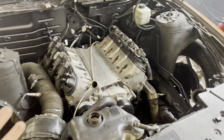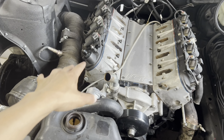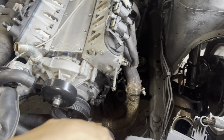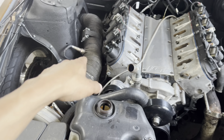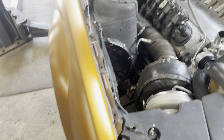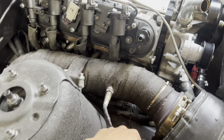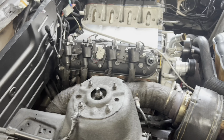We got most of the top end stuff off. I now have to basically take out the v-bands for the exhaust manifolds on both sides, take off the turbo, the downpipe with the teardrop exhaust pipe, and disconnect the O2 sensor. But it's fairly simple, pretty easy.